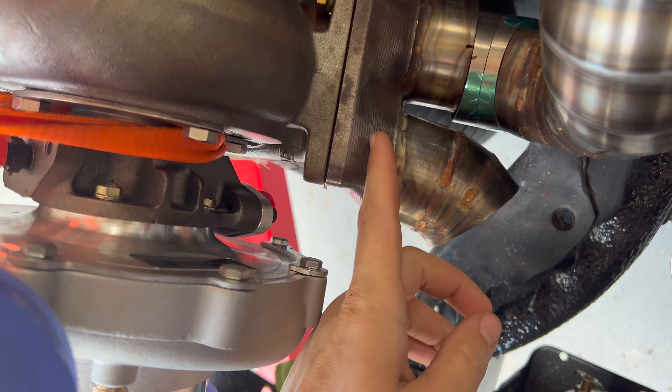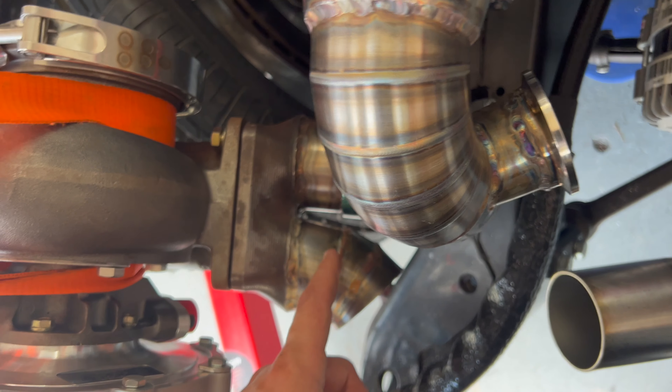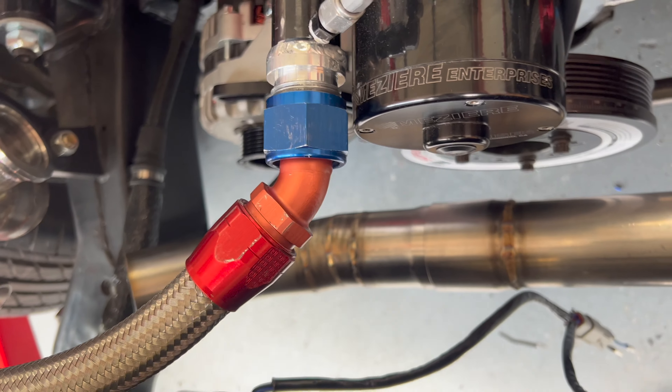The short side is done, which is good. I've already cut up the original flange right here, so I'm probably going to make another cut right before this weld — that way it'll be a straighter shot over here. I can still move this a little bit. Our double slip fitting — I don't know what happened with it, either I welded it wrong or it's just a super tight tolerance fit. I called Stainless Headers and they said it should be in and out like butter when it's not welded, and it was not. I sent them a video and they said it's fine, so I welded it and it's not fine. That's probably one of the main reasons we'll just redo the entire hot side once we go to one of the big turbos.